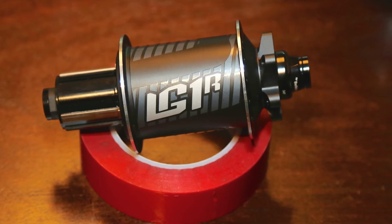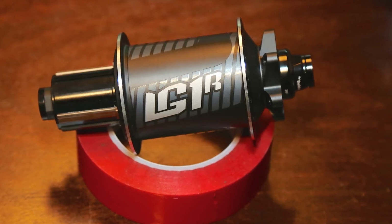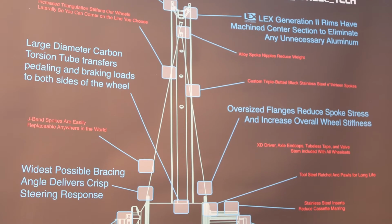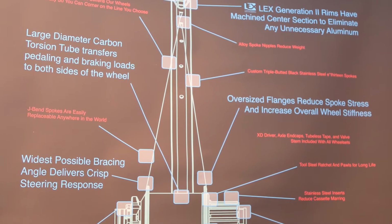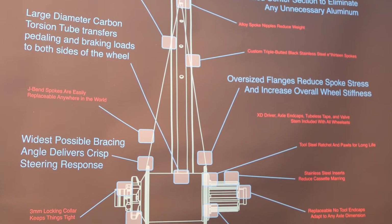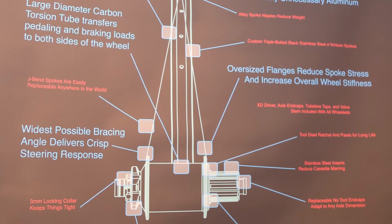So what we have done is gone with a higher grade radial bearing now in all the wheels, and it makes it easy as far as the adjustment and basically replacement or any service on the hubs. So now tighten them down till they're tight, lock the little cinch bolt, and you're ready to go.